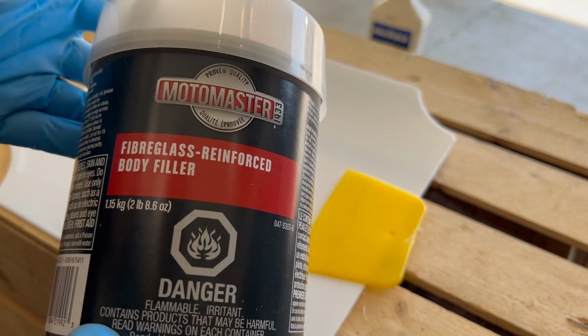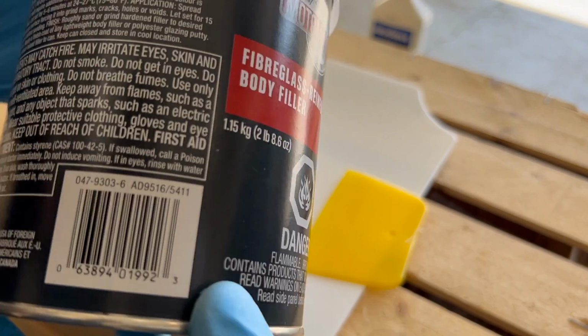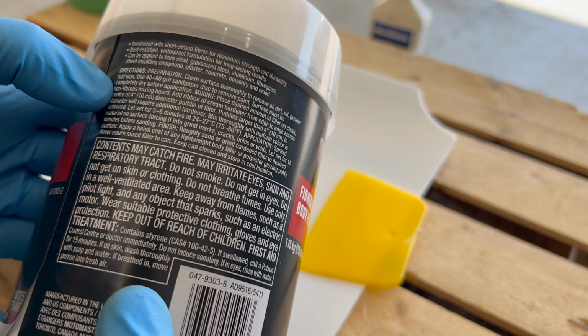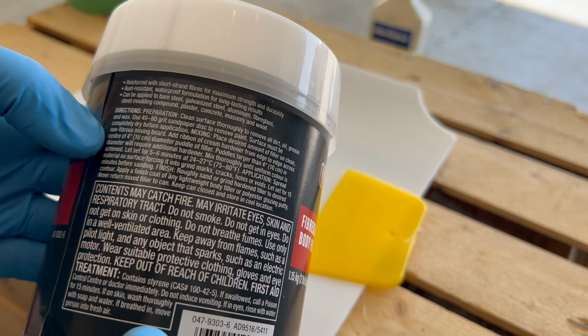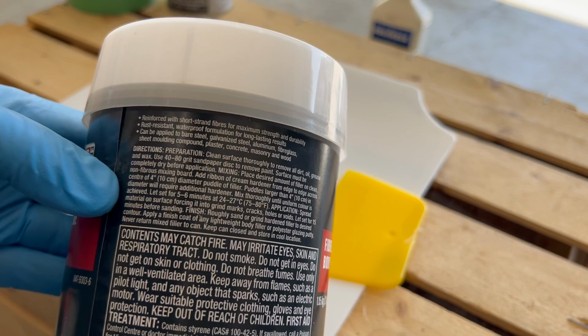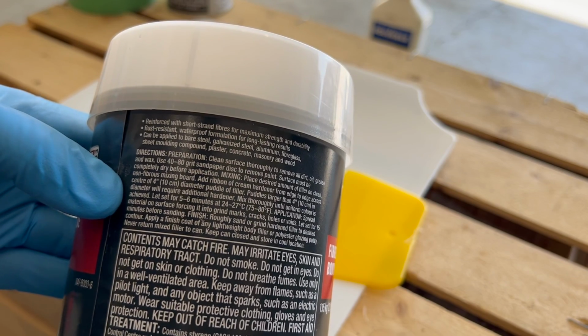Because I had all that pitting and of course that hole, I'm going to use a fiberglass body filler to give it extra strength. The directions, or Coles notes, are as follows. This product is reinforced with short strands of fiber. Thoroughly remove all dirt. Use 40 or 80 grit sandpaper to remove all paint. This kit also comes with a cream hardener, and you can always buy more hardener separately if you have extra body filler, but no hardener.